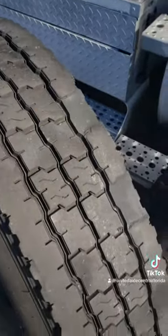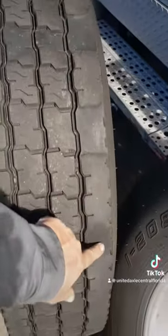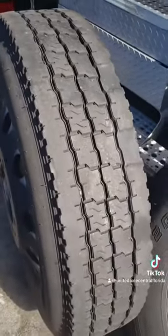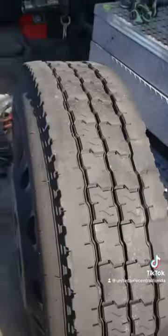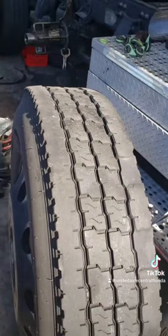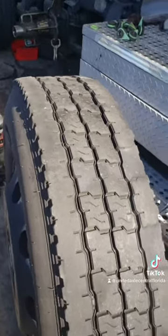See the chopping on these tires — it's hard to pick up on video, but that's either from the spindle being worn or not having the correct preload on your bearings. That's something you drivers need to look at if you're getting funny tire wear in one position and not the others, because the rest of the tires on this truck are in good shape. Have somebody check your wheel bearings and maybe get into it a little bit deeper.